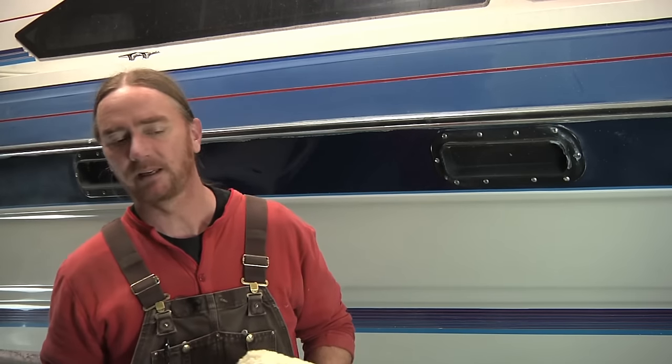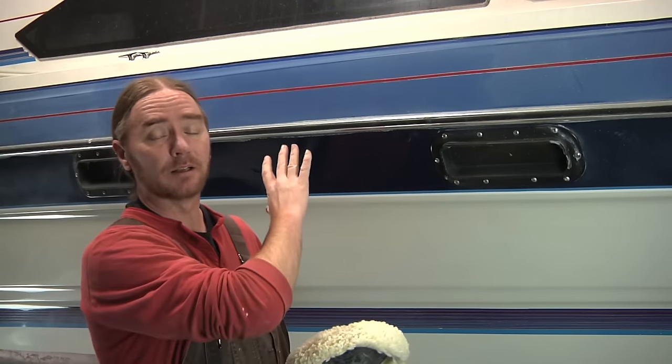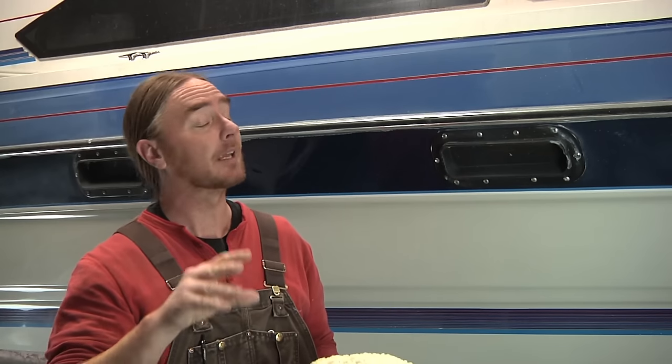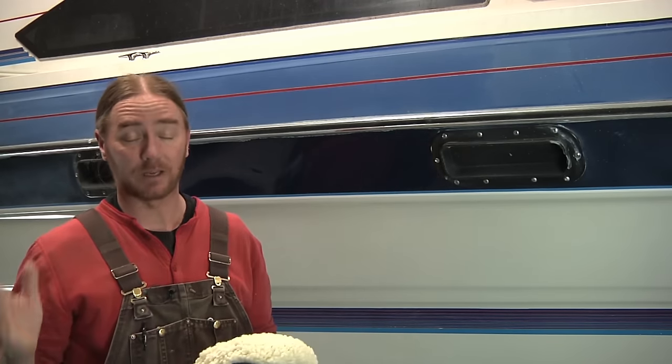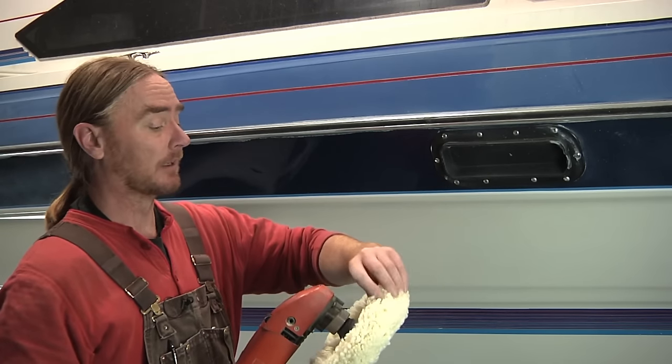Compounds generally operate on what's called a diminishing abrasive. What that means is that when they first start, you can feel some grit in the compound in your fingers. But as that grit is worked with the buffer, those grit particles shatter — they break down and become more and more fine the longer it's worked. So another reason to run this buffer slow is to give those grit particles enough working time where they continue breaking down and eventually turn into almost a polish. Although this oxidation remover is technically a heavy-duty compound, if you run the buffer slow it finishes very similar to a polish, which means you can compound and polish all in one step — it's a very convenient time saver and just a good product.